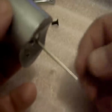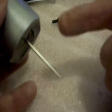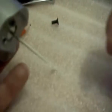You'll feel it move. Now if it's on the first position, that means the needle point is further down into the jet — that will be the leanest possible position because it's occluding the jet more. If you push it down to the second position it'll come up a bit. Usually second or third position would be normal, then third, then fourth. Fourth would be very unusual — it'd be very rich because the needle is so far up that it's not occluding anything down there.